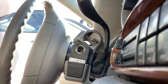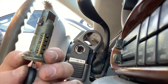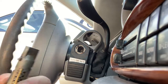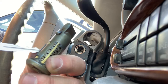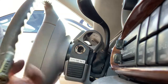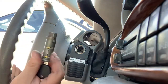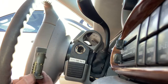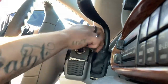Alright guys, we're back. We've made our key — there you have it, and there's the sidebar sitting flush. Check our key in the doors — it works! Checking the glove box — works. As you can see, for those who don't know: there's our sidebar right there, you can see it sitting up. As soon as we insert the key it sits down — that's what lets us turn it. So I'm going to put everything back on before I insert the lock cylinder back in, just to maybe make it easier. Everything should just slap right back into place.